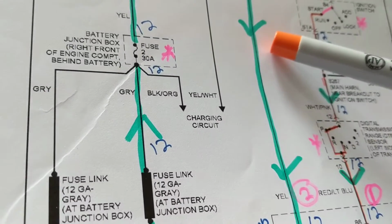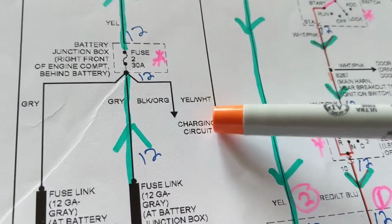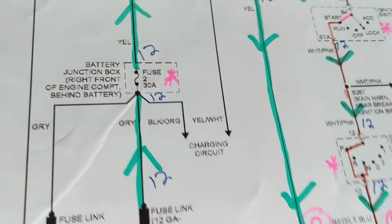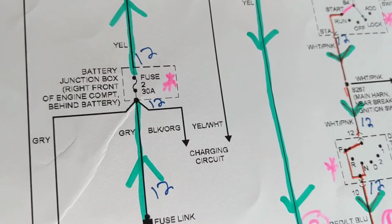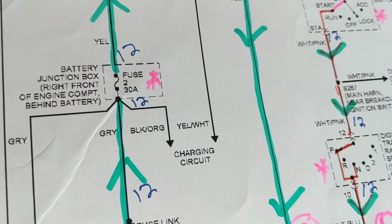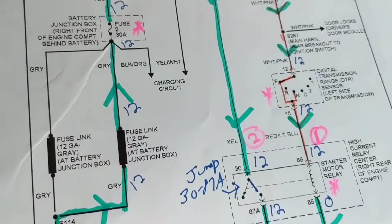Now let's say your car is dead. Well, the battery is dead. What you have to think right away is, is it the battery or did something cause it to get to that state? A few things, obviously: a parasitic draw, corrosion, other things. But like I said, the alternator has to do its job and recharge the battery.